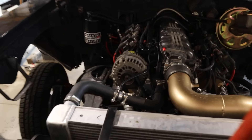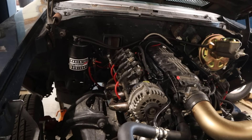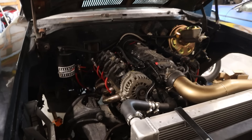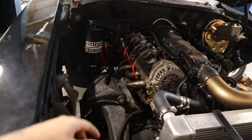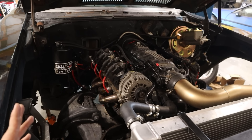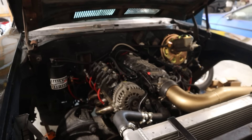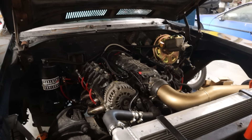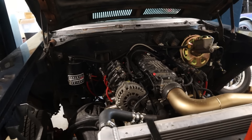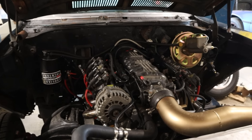I've got a bunch of turbo stuff laying around, but I've already got such a nice exhaust system on this thing that I don't want to pull it apart to put a turbo on. So I'd like to do some bolt-on boost. It is a Gen 4 5.3, it does have 243 heads which are pretty good, so it's in the neighborhood of like 9.5 to 1 compression - could be close to 10 to 1 depending on gasket thicknesses. BBK SSI intake, which I got like five or six years ago from a neighbor across the street from my dad - shout out to Andre. That was actually on the RX-7 when that thing went 9.5 at 140.